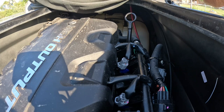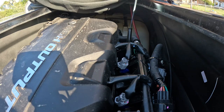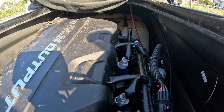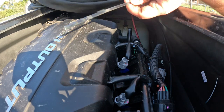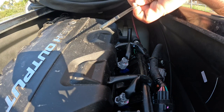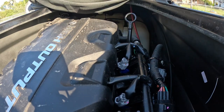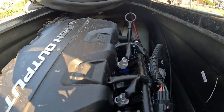It's run for a couple minutes now — check the oil, clean off the dipstick first, then check it. Looks like it's most of the way up. That's at the full line, so we don't even need to top it off — it's full right now. Just make sure you clean up all your mess, including the pad underneath the filter if you had one. And that's it — hope this video helped you guys.